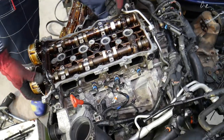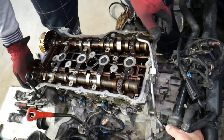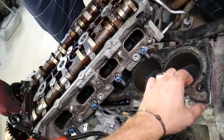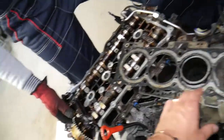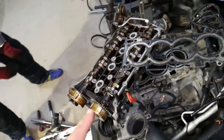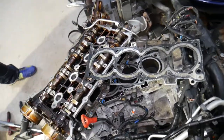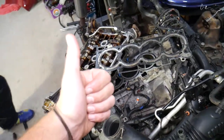Now lift the cylinder head up — it's a little bit stuck. Get the gasket out and never leave it on the block. The cylinder head and cylinder head gasket are now out. For putting everything back together, including cylinder head gasket torque specs and torque sequence, and timing chain installation for the Hyundai Sonata, those videos are on our channel. We also have a video on the symptoms of a bad cylinder head gasket. Hopefully this video was helpful — thank you for watching!